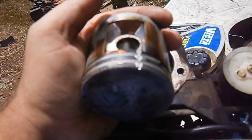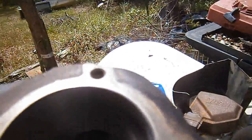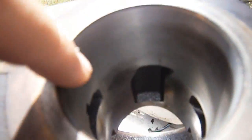That's the right way up for the piston, with that mark on the top. As you can see, there's a little tiny nick in the back, but there's nothing that would catch a ring.